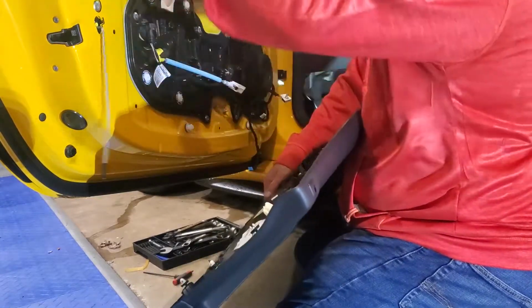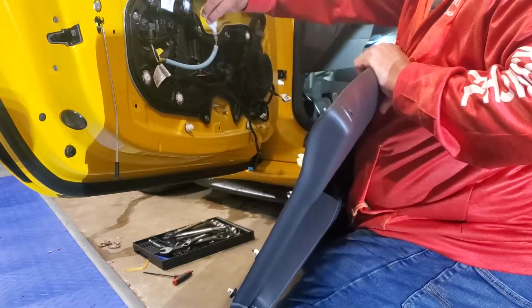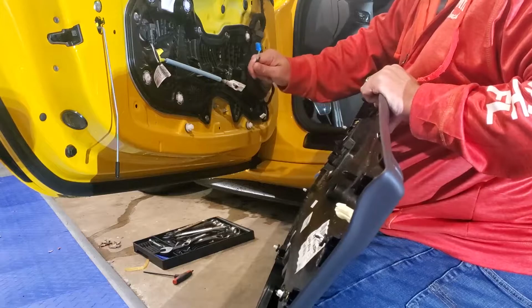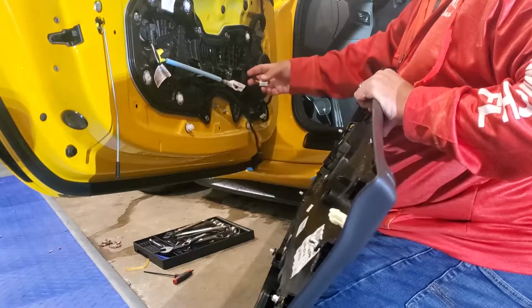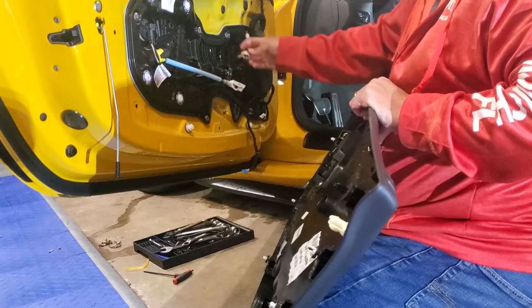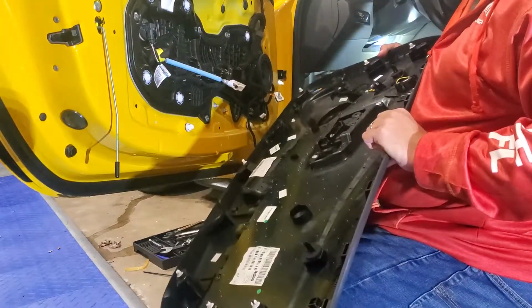The door lock mechanism just falls. The door handle part just literally poof, unclips. And then you have a little bit of a harness here. Some of these little blue ones just pull out with a little pressure. And then this is more like a Molex locking one. So it has a little tiny press-in on the top. You press it in so you can rotate this and it just kind of unsockets itself, and then you have a nice clean door panel off here.